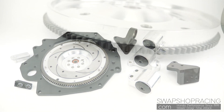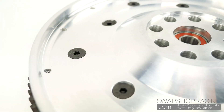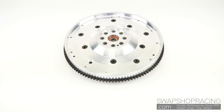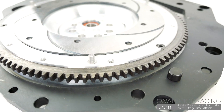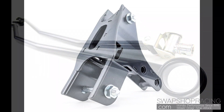Also comes along with detailed instructions. The flywheel included with this kit already has spacing for the H2B adapter plate built into it, so there is no need to use a spacer or extended flywheel bolts. Designed for B-series engine positioning, you can use B-series axles, shift linkage, and rear engine bracket.